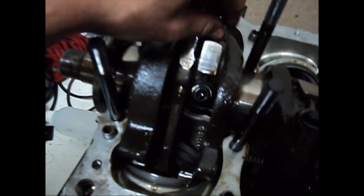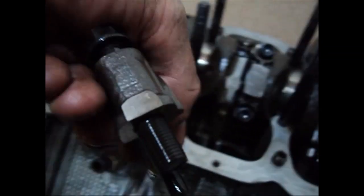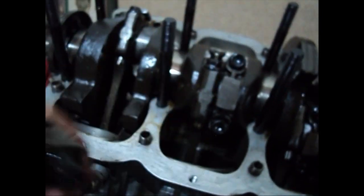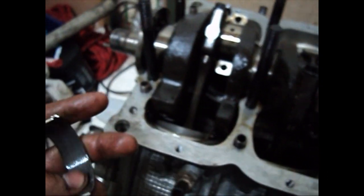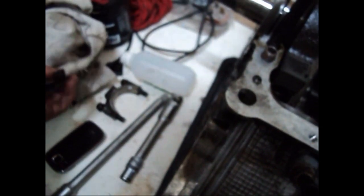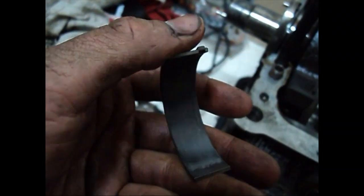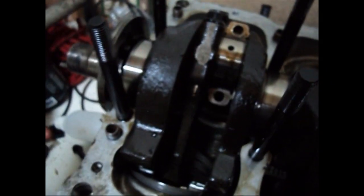Here we have the pistons and I'm going to disassemble the connecting rod. Take this one off — it has the number on one side only, which makes it easy to identify. As regards to the white metal here, it's pretty neat — clean it up so you can see. As you can see, this one is pretty neat, so we have no side problems here.